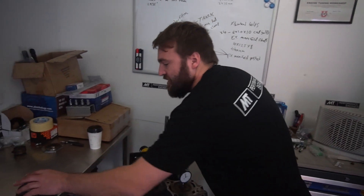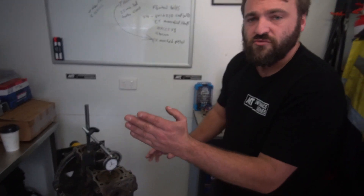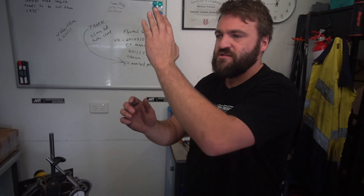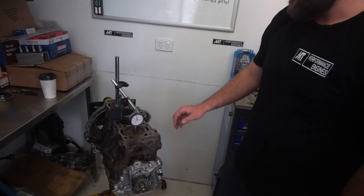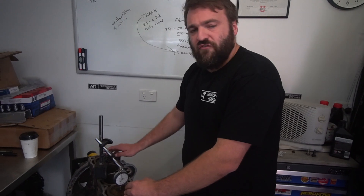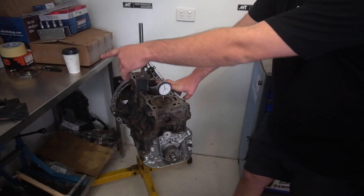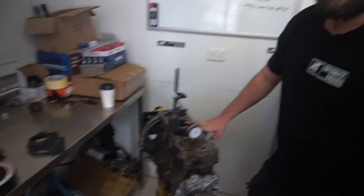So when we go and attach this and set it to zero, we should see as we come up to zero that our dial gauge reaches its peak before falling. You're going to have dwell — a period of time as the piston comes over top dead center where it dwells for a short amount of time before falling — but we should still be within zero degrees. Because I've got a dummy piston and rod set up in this block, we can test number one and four, and then exactly 180 degrees over, test two and three. We should see that replicated on our plastic timing cover that gives us a zero mark, five degrees either side, and a 180-degree mark on our harmonic balancer.